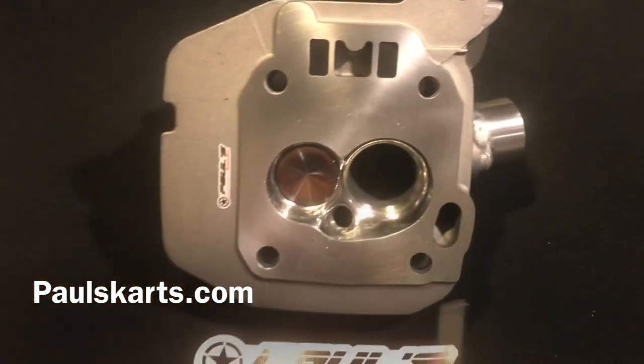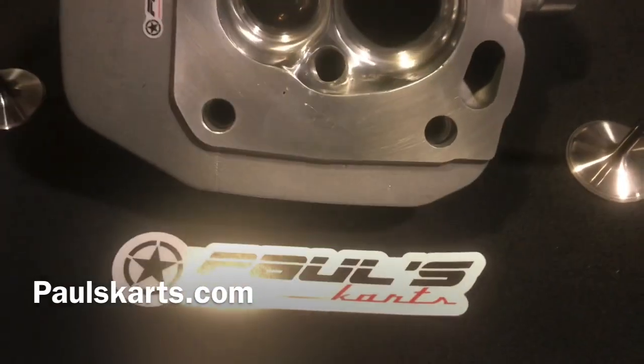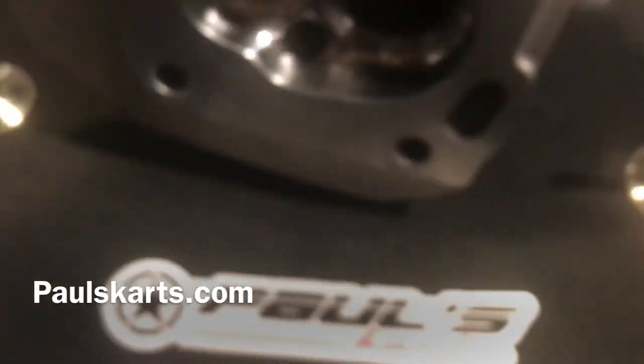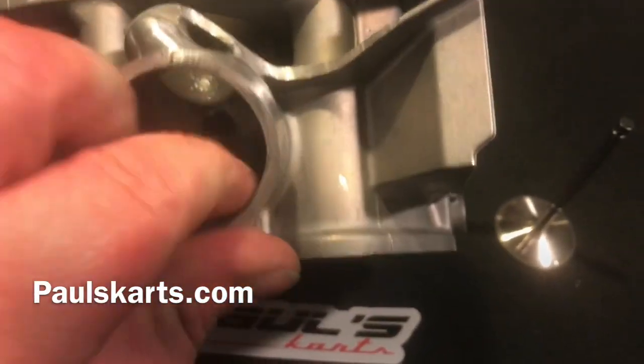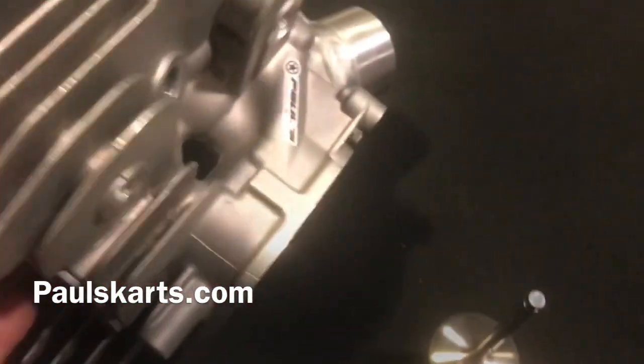I can try to take these valves out and show you the ports and stuff. It actually has really nice porting. It's like a mirror in there — you get to a point where it becomes so shiny that you start getting crazy with the polishing. And this intake is massive. With a 43mm valve you need a big port, so we did the welded intake tube on this. As you can see, we really got this thing dialed in nice. I'll show you down the port if I can get some light in there. So that's what it looks like down the port — really nice cylinder head.